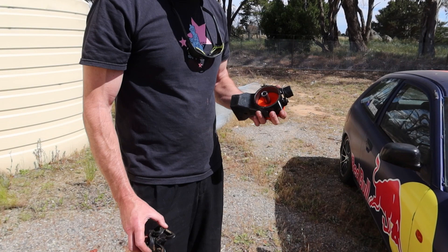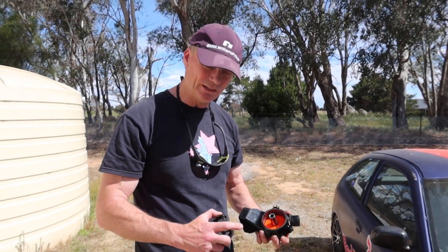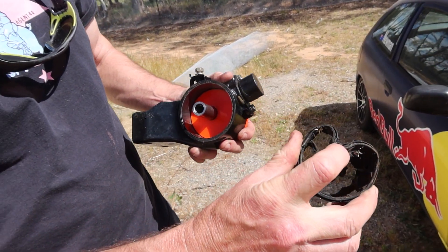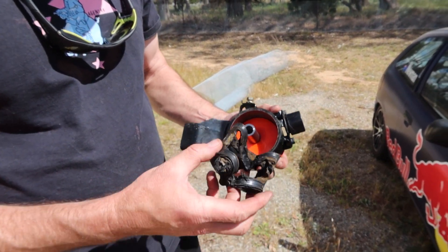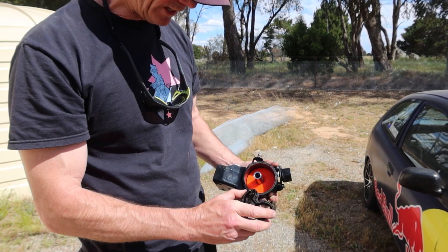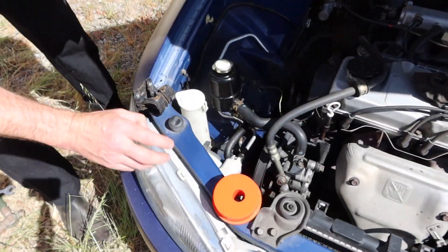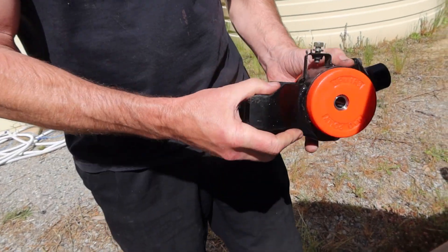Keep an eye out for Silpy Sam. What have you got there? This is what happens when you remove the bush. There's an inner race, and the rubber bit is bonded to it. We were trying to get the rubber bit out and there was a bit hanging down, so we just bashed it. I think you used the blowtorch on that one. Yeah, we did. But the second one for the Lancer I just used a hole saw and cut the rubber bush out, then grabbed hold of it and whacked it out. It's full of oil so it's super messy — get it on your face, that's all good for you. Then we shove these bushes in. Knock that out, you don't need it. Here's your bush — that one should just slide on there and then we're ready to pop it on.